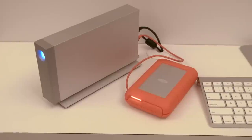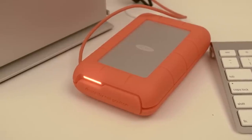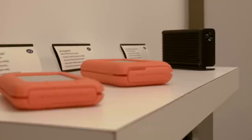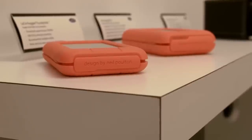Next is more of a product update than a whole new idea: the LaCie Rugged RAID, an update to their previous single-drive rugged product — now a dual-drive version. It's more prosumer than consumer. It's got Thunderbolt or USB 3; Thunderbolt is completely bus-powered with no auxiliary power required, though USB 3 needs an additional adapter. It has a hardware RAID controller configurable in RAID 0 or RAID 1 — though if you're protecting data in a thick rubber enclosure, you should probably run RAID 1.